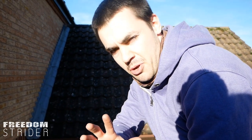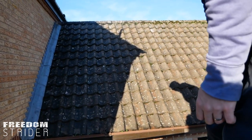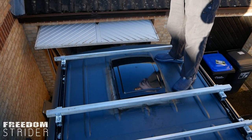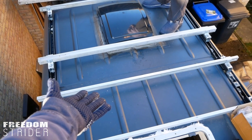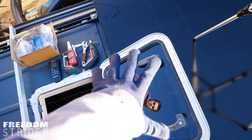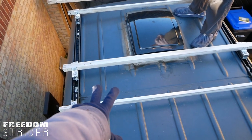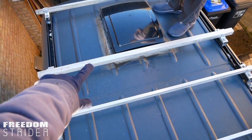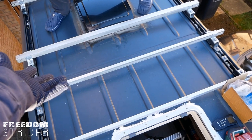The sun is out — it's beautiful at the moment on the roof. The sun's melted all the ice so we're warm at the moment. Let's hurry up because we won't be warm in a few hours. We've got three more to bolt on, let's crack on. They're bolted in. That is roof rack 1.0 — the smallest thing we could build. Eventually we'll stretch it at least here and hopefully underneath the solar panels, but right now we're not going to worry about that. Let's make this work first. Now we're going to measure the platforms we need — from this beam to the center of the double beam, and then from the center of the double beam to the back of the van. They're relatively parallel, I think. We're about to find out.